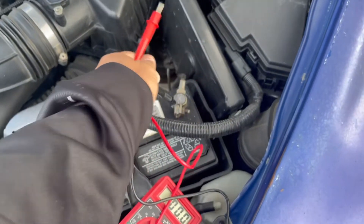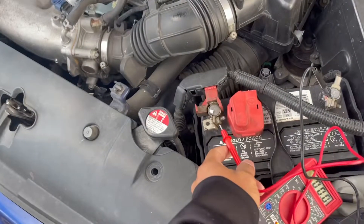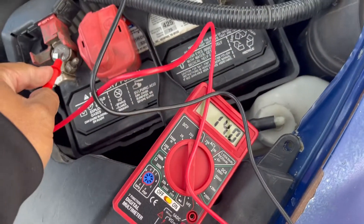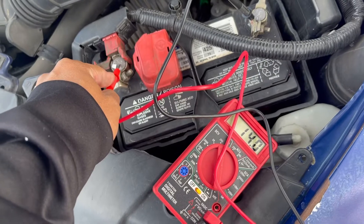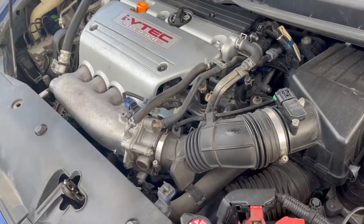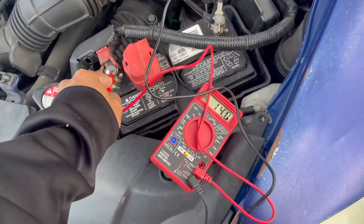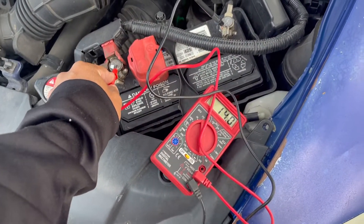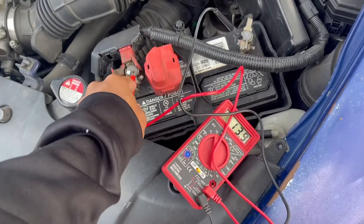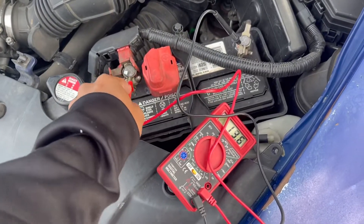Since I got the car started I moved it to the parking lot just to test the battery. Now we're at 13 to 14 volts — that's where it should be. So yeah, it shows how strong that jump starter is. It's a small battery, it's 425, but it's your normal use for normal cars.